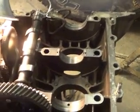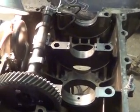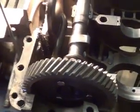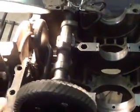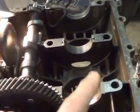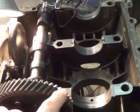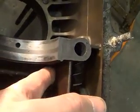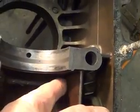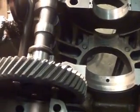I looked in my pile of stuff — this is an old 1966 1300 case that's been sitting around — and I took it upon myself to look in this one. I'm just sharing information here, and I know Darren knows all of this stuff, but some of you guys might want to know. The crankshaft in a Volkswagen turns clockwise, so the camshaft turns counterclockwise, and any oil that's getting flung off of this gear is going to be coming to the distributor side of the case. On the other side of the case is where your generator stand bolts on. There's a little shelf up here and a space in the back where, when you add oil to your car, it falls down and keeps your oil from spraying up and coming out your oil breather more than necessary.